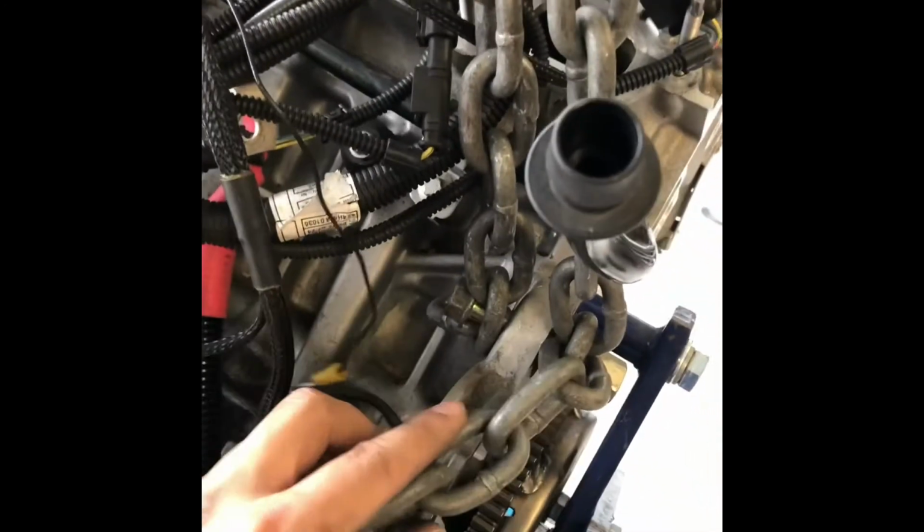I can maybe start removing some stuff, but later on I am gonna take the engine back off and take the flex plate off once I get the bolts that I need. And somebody asked me about where the loop was on the engine to hang your rear chain from. It's right above the starter. That's where the starter bolts up. And right above there, there's like a loop, and nothing goes in there other than, obviously, your chain.